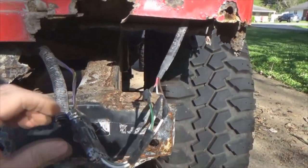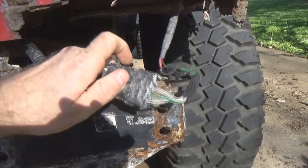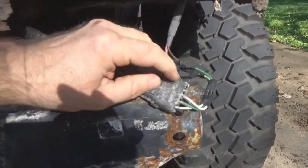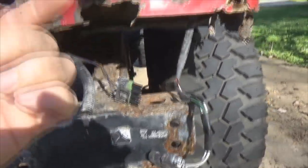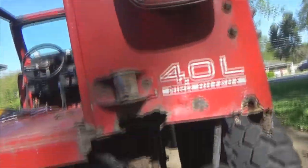So let's get on with getting these taillights out. Now you can see somebody's already tapped into the wiring here, but what you would normally do is just plug right here, pull this back. There we go — separate the plug. Now electrically this one's loose.